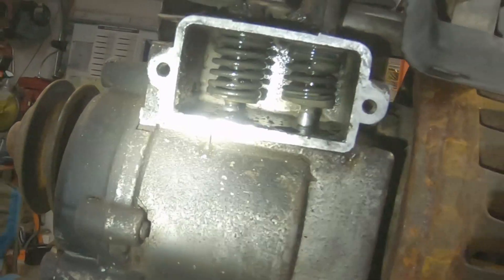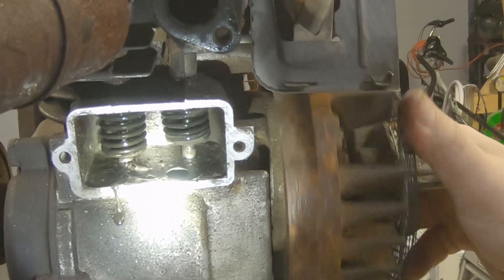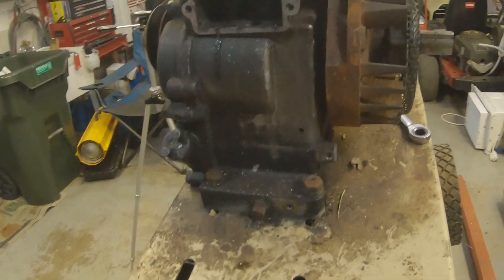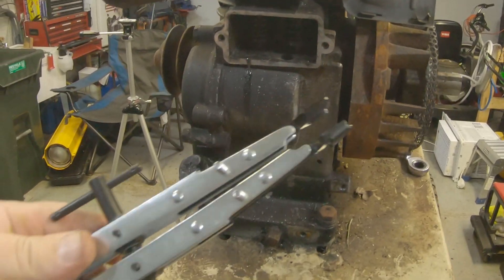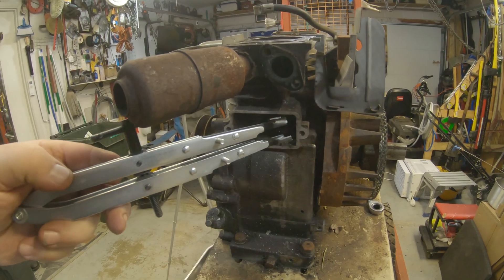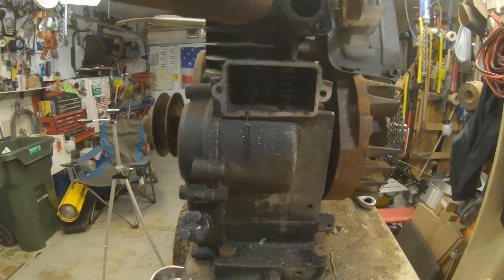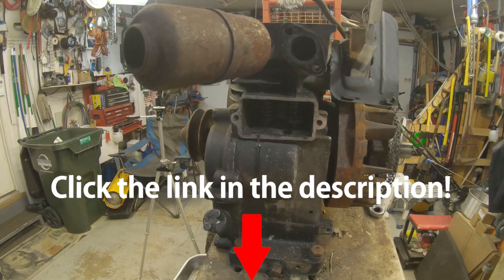I don't see any broken spring or anything. Let's get these springs out of here and see what these valves look like. If you've never worked on one of these engines, these valve springs can be kind of a pain to get out if you don't have the right kind of tool. But this tool here — the valve spring compressor — fits in there so you can get these valve springs out pretty easy and get the keepers off the bottom of them. You can do this with screwdrivers and pliers, but I'll put a link down below the video — the $20 tool is the way to go.